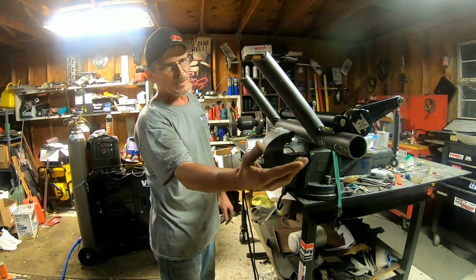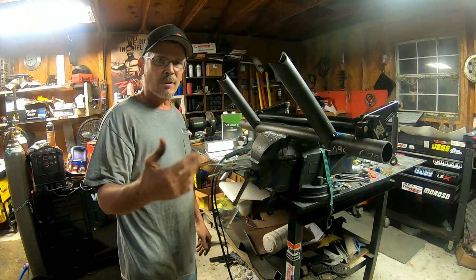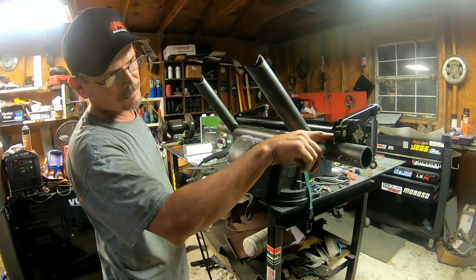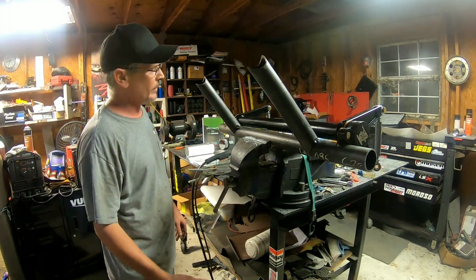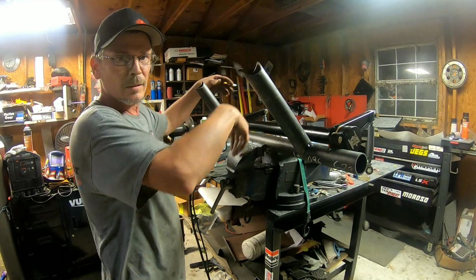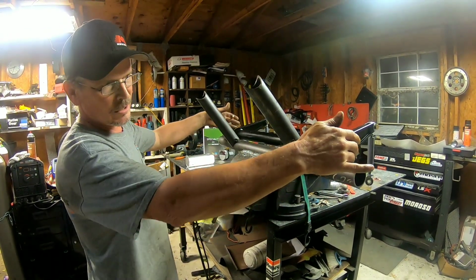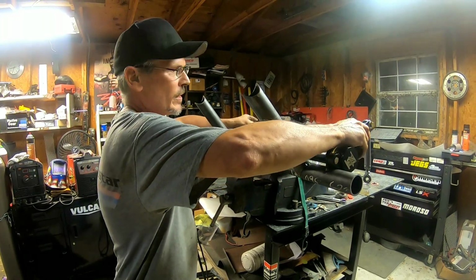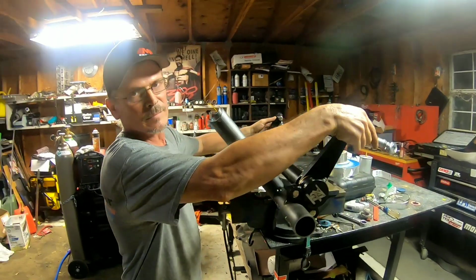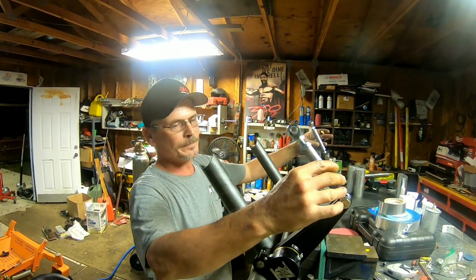What's up? So what we did was we measured off our bar, checked to see that that was the right width that we wanted. We came off these a little bit, welded these tabs on. Looked pretty good there. Whenever you take the bolts off, you can pull the caps off and the ARB comes off. We set this up underneath the car where I wanted it, where these will be horizontal. These will flip over and connect to the axle tubes.